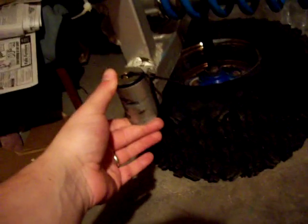And then I finished doing my swing arm bearings last night. Did all brand new linkage bearings, cushion bearings. I had the shock rebuilt at Brothers Motorsports in Brainerd, and gonna go through the rear carrier still. Just finished that last night, so I'll start working on the rear carrier next. But getting pretty close.